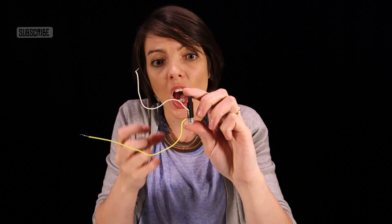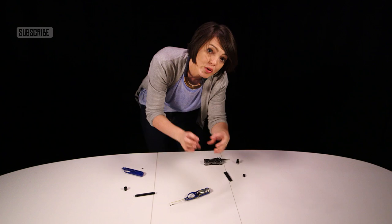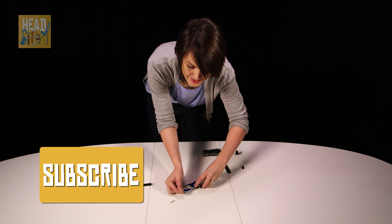This all fits into the cooker lighter because when I push this button right here, it's actually a spring-loaded hammer pushing down on the piezoelectric crystal inside there, generating the voltage. The lighter fits in to the side of the butane tank like that, and these yellow and white wires take the voltage from the piezoelectric crystal and carry it up to the igniter end — ending up between these two tips. When you push the button, there's a nice spark between them, and it's that spark that lights your cooker lighter.